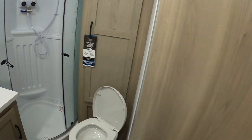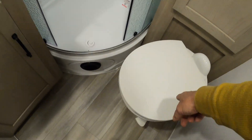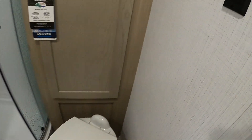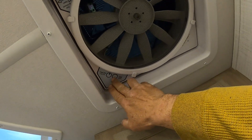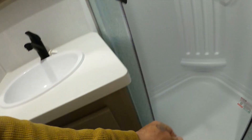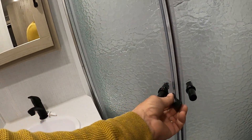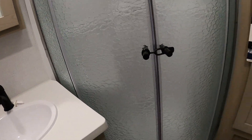In the bathroom — a couple of flushes of your toilet when you first arrive to put some water down into your black tank; your black tank will thank you later. You've got lighting, a hand-crank open exhaust vent, a little plumbing to maintain, and an access panel with square-headed screws. The shower door should be kept snapped closed for travel.